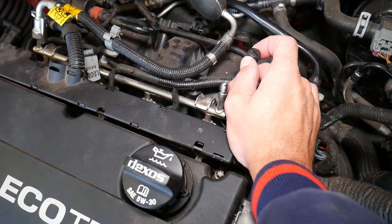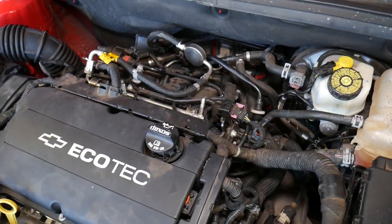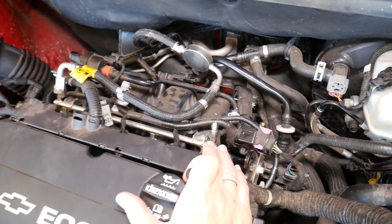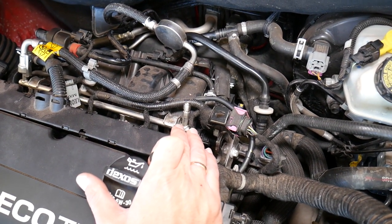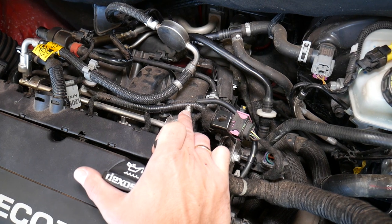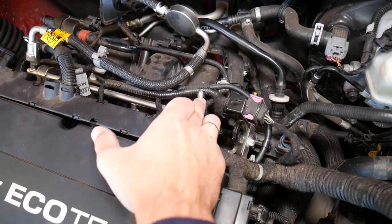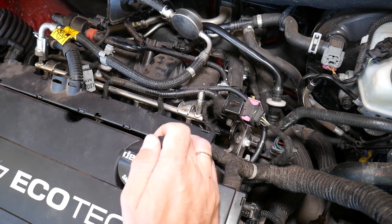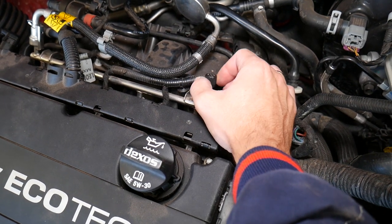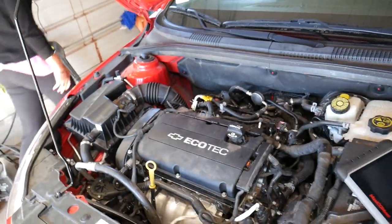If you don't have the tool, I do not recommend doing it without one. What we sometimes do in the shop — and this requires an extremely cold engine, no spark, no smoking, and a fire extinguisher on the side — is remove the needle slowly, because it will be under enormous pressure, then connect a hose to a bottle and turn the ignition on to see if it pumps fuel. But do not do that without the correct tools. I've seen people set themselves on fire — I actually caught a car on fire myself that way.